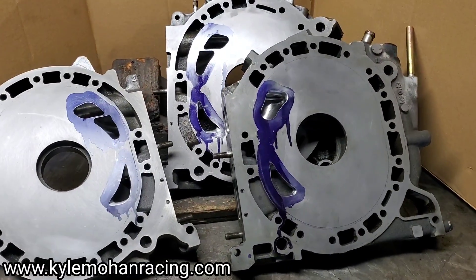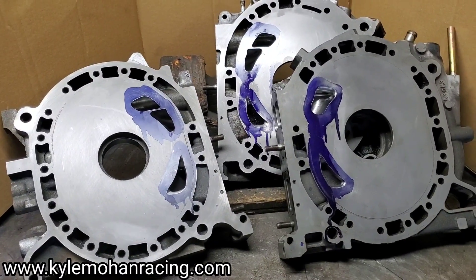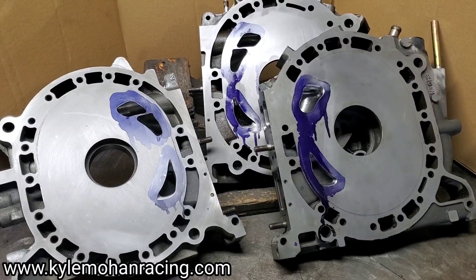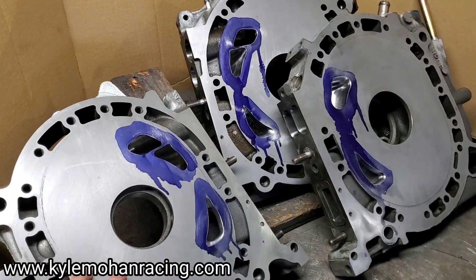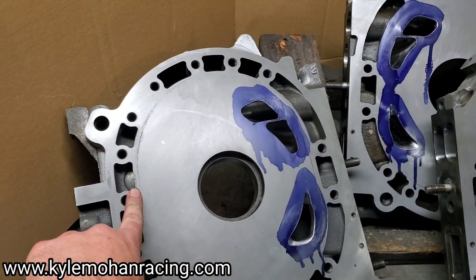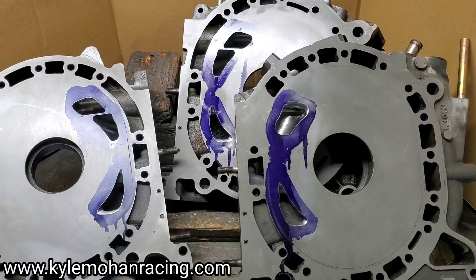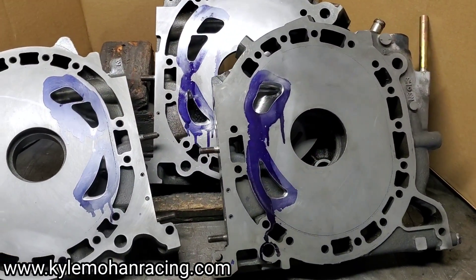These housings came in and they were absolutely dirty, burned, used up. A lot of people don't really understand that the point of lapping or resurfacing side housings is to bring back housings that may not have had another chance at running. If you've got a perfectly good set of housings with very little miles on it, I'm probably not going to recommend lapping. These particular housings had warpage around the exhaust ports, water damage, corrosion, and substantial wear and some burn marks. I don't know what happened to them in their lifespan, but they were basically used up.